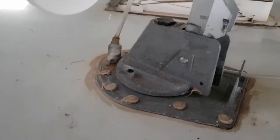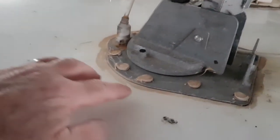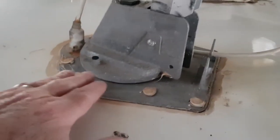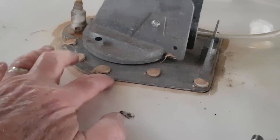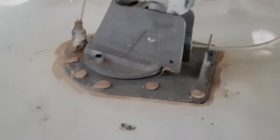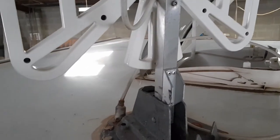While you're up here, it's a good idea to check there are no obvious gaps around underneath that seal. If that seal goes - not enough sealant, it's missing, or it's fallen off - water will get in and leak into your roof. So it's a good opportunity to have a look.